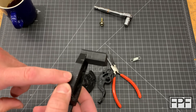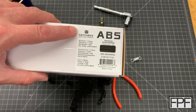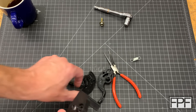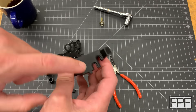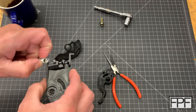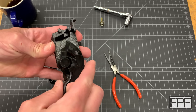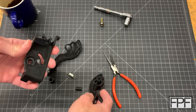This was printed in Hatchbox ABS — the best material I had at the time because this had to be highly temperature resistant since it is in a car. It gets well over 100 degrees in there while it's parked. I'm also realizing we should have two springs. There are actually two little perches here for springs — I think I removed one just now, and without this stop, the part would have been able to rotate to the point where that spring would just fall right off. I wonder if that's still in the car.